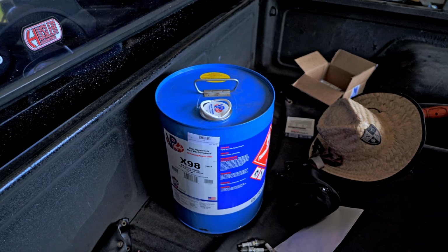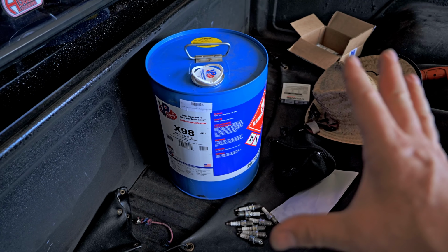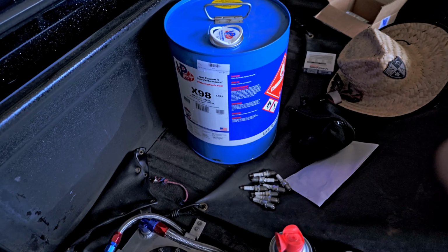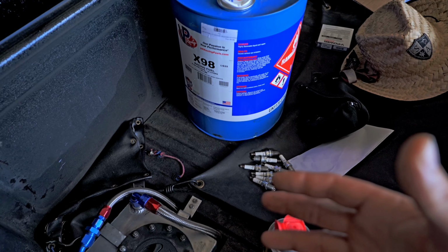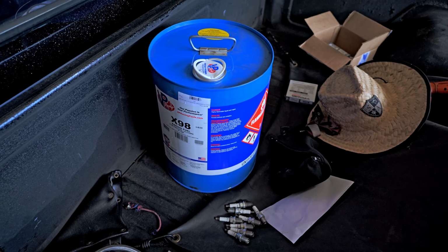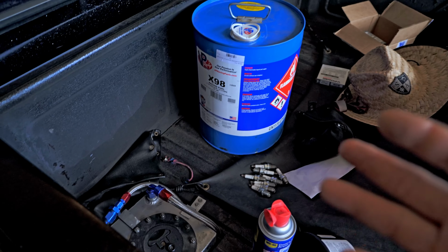So you got that 93 or 87 gas in there. When that chemical process happens and they're splitting, my guess, like I said, this is just a theory, is that the cheap gas they're putting in the pump E85 is igniting first and then burning the ethanol, which can cause pre-ignition. So one way to defeat knock, or timing issues, is to just throw a whole bunch of fuel at it so it can't burn it all. So maybe that's the reason why, to make a motor live on E85, you got to run it super fat on nitrous and not so much on boost.